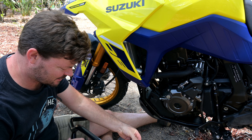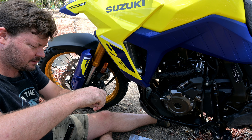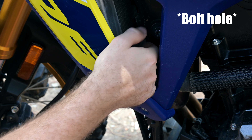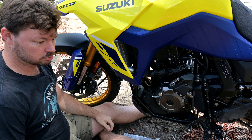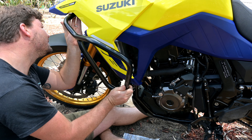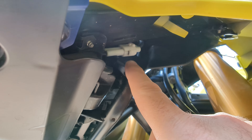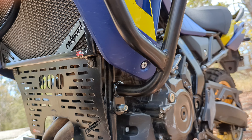So we're going to pop our connector on, put that in there. Bolt and threadlocker - a bit generous again. If you can't find where your bolt is here, it's because there's a rubber flap here for some reason. I just need to cut this tiny bit out of the front - you can get to the hole now. Pretty easy to do, you just have to cut out that little bit. Let's mount this sucker. I've had some issues but we got there in the end. I've mocked it up - put that one on the bottom to hold it in, then put it all the way up in there. There's a connector up in there that I had to push up since I couldn't pull it down out of the way to mount it onto that spot.